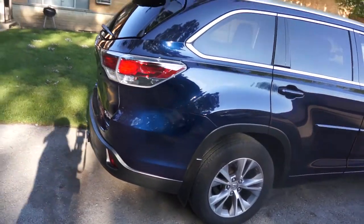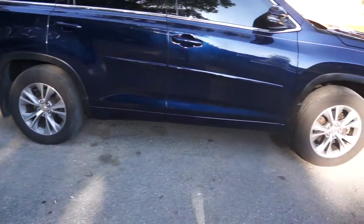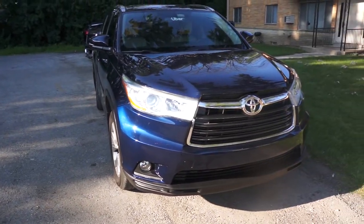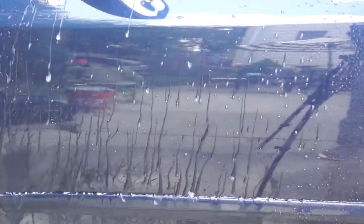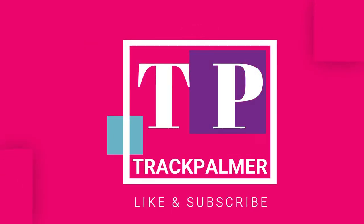And this is the end result after applying two coats of C-Quartz ceramic coating. I'm really pleased with the result. One key thing to note — you should avoid water touching the ceramic coating for at least 24 hours after you apply the ceramic coat. And this is 7 days later and you can see how easily the water beads off the ceramic coat. I gave the car a first wash and it is time to apply the reload. That's the end guys — thank you for watching. If you found this video helpful please give a like and remember to subscribe for similar videos. See you on the next one guys. Bye.